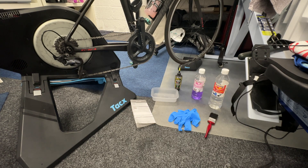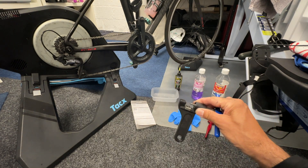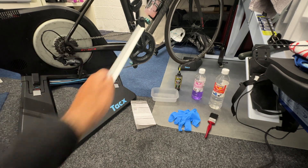Now you're ready to put the chain onto the bicycle. I have a SRAM chain, and I had to look up the instructions online. The instructions covered fitting the cassette etc., but for joining the chain, the quick link is what connects it — no special pin needed. Most modern chains have a quick link: two sides of a link that slide together. There's a little arrow on it that must face the direction of travel.